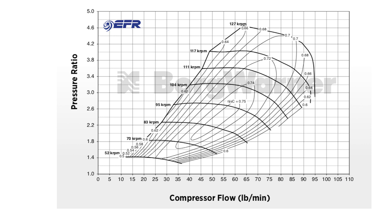So let's say there is a slight boost leak occurring before the intercooler, and your MAP sensor — which you're referencing your boost pressure from — is sitting after your butterfly or installed into your intake manifold. You would be seeing 1.6 bar boost, but because there's a boost leak before the MAP sensor, the turbocharger's rotational speed will be much higher — it might be 104,000, 120,000, or 130,000 RPM — trying to maintain that 1.6 bar boost. But not all of that flow is going into the engine, which is why you're only consuming 40 pounds per minute and making 400 horsepower. If you had a turbocharger speed gauge, you'd be able to say: we're running at a high RPM but only consuming 40 pounds per minute at 1.6 bar — let's look somewhere else for the problem.